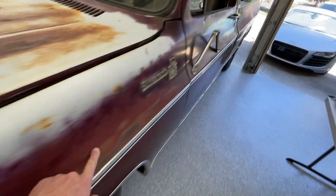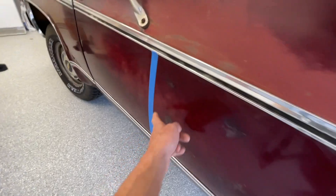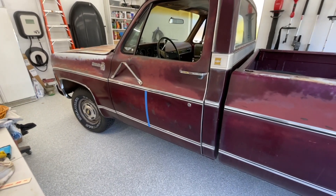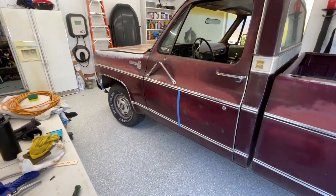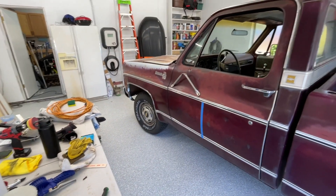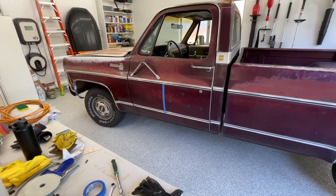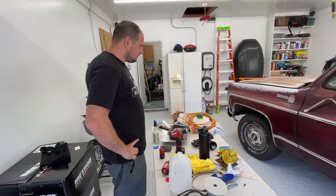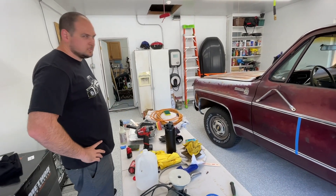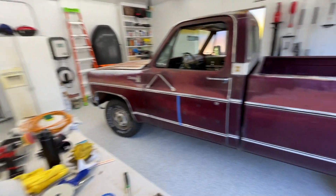There's no red to recover, so I'd rather have it a little rusty than a primered-looking hood. But there's still stuff we can kind of get out — we took out a spot right here that looks a lot better now. This is really thin. What about just oiling it? You were trying to shine it up a little first, get some of that top layer of dead paint off. Otherwise it's going to come right back pretty quick. But if we can get that little top layer off, we can probably keep some shine. And then when we put a sealant or something on it, it'll last a little longer.